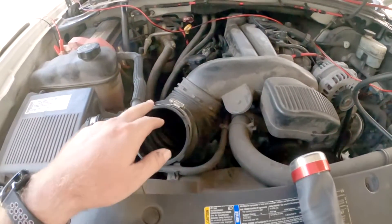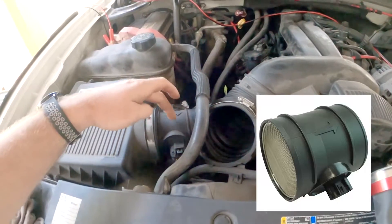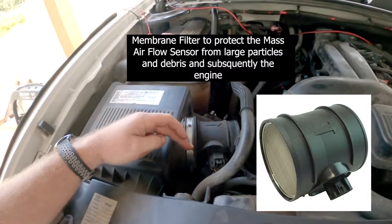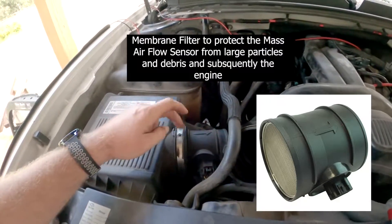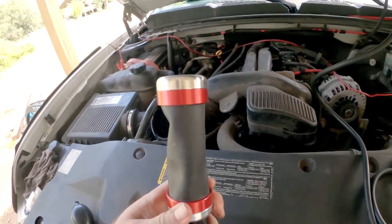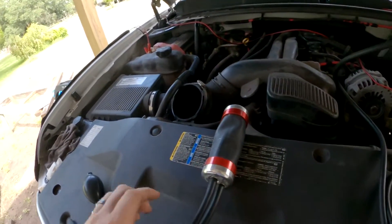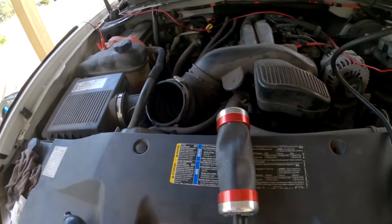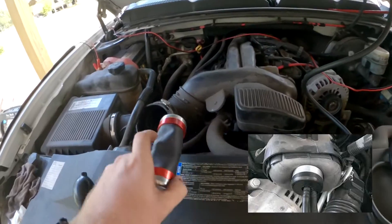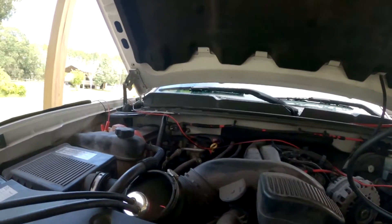I disconnected at this point rather than downstream of the sensor, because there's actually a filter here so I can't get my tool in there. What I'm going to use is this Smoke Pro - basically a mechanical inflation seal-off tool that is absolutely awesome. You can fill odd-shaped diameter holes with it. That's what I'm going to do here, bear with me.